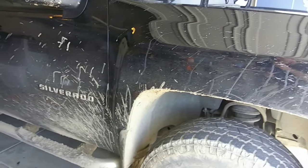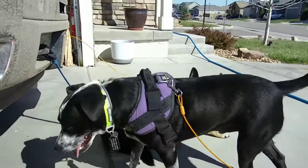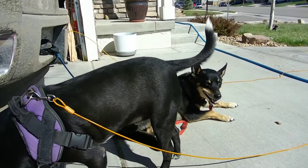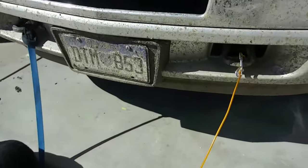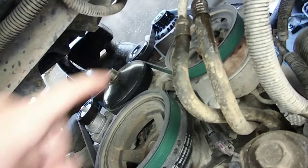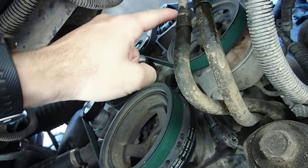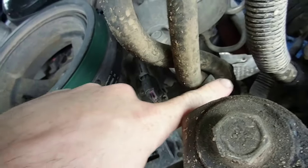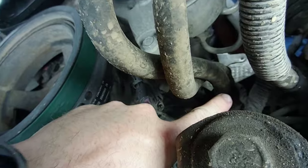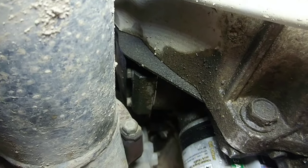Sure am glad I forgot to wash her before I got started. Oh well. Got the dogs tied to the truck — they're happy. It sure is nice of Chevy to put these leash anchor points on the bumper. Anyways, here's the oil cooler lines. Mine's leaking out of that usual spot. The other one's not too bad, but they come in a pair and they go right between the engine mount and the front axle. Tight space — that's why Chevy says you need to drop the front axle. This would be expensive at the dealership.